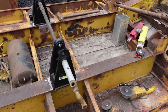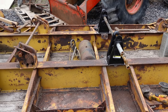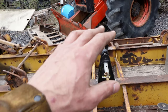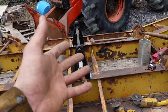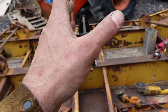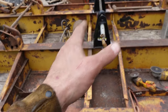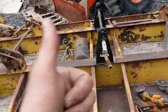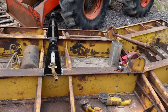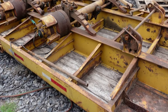I think I have a stick back in the shop, but we'll see if we can get the brackets on. There's plenty to do even without the right pipe here, so no biggie. We'll keep moving. This will work. That's got us lined up pretty darn well, and really the springs have enough play that if it's off by 1/4 degree, I don't even think it is, I measured a lot, it'll be fine. They're square to the frame, they're in the right spot. That's all I really need on these. They're certainly within a 1/32 of an inch where they need to be, and it's plenty of precision for this old piece of junk. So let me get welding.